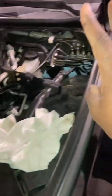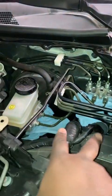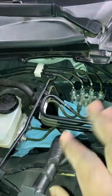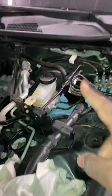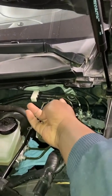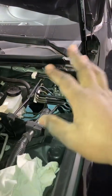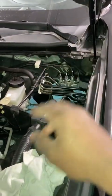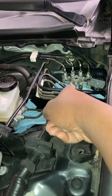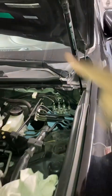A vehicle has two circuits in a master cylinder. Do you see you've got two tubes coming out of there? Two tubes going into two places on the ABS module. The reason is your vehicle has two brake circuits. If you cut a brake line over here, ideally you're not going to lose braking capacity all over because you're leaking fluid from just that one circuit.